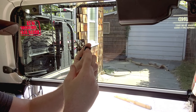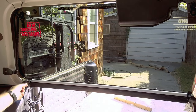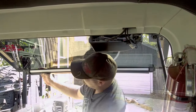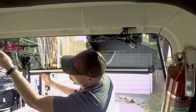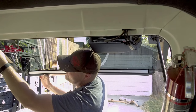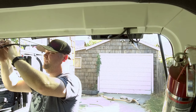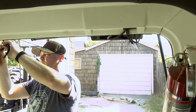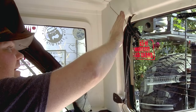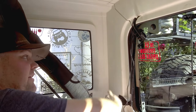Now we're going to run the power cable up the side and snake it down around the rear. The kit comes with eight wire holders that have 3M adhesive tape on the back — we're going to run these up the side of the glass. Make sure your glass is clean, so go ahead and get some glass cleaner and wipe it down. Run the wire through the holders and snap them into place. You also have a power cable for your defroster — you can zip tie the wire, and the kit comes with a plastic cable manager to slide on there to clean up the look and make it look more professional.